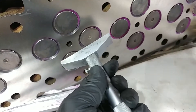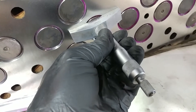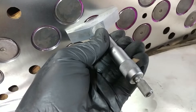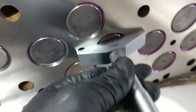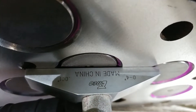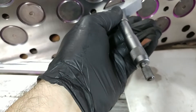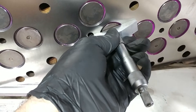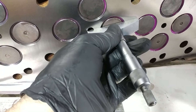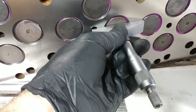What we do is place this flat against the surface and roll it back, then roll it forward. This takes a gentle feel. We make sure we're not touching the face of the valve when we start — we're flat against the deck of the cylinder. We then roll it in until it bottoms out.